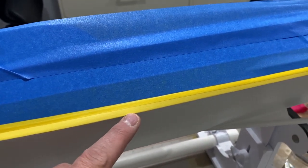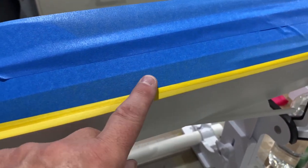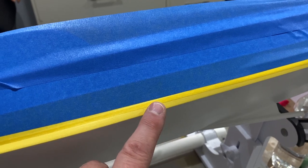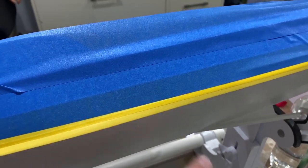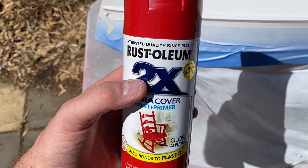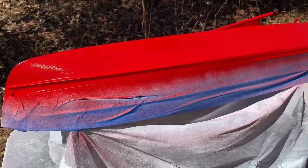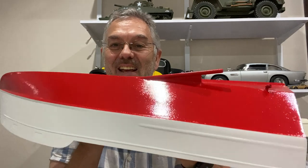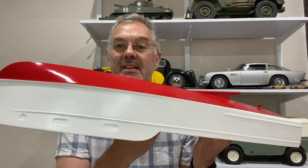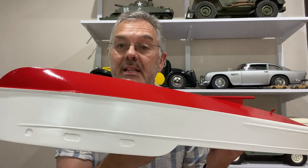So I've got all this masked up. I'm going to use a little trick I read about on the internet to stop the red paint bleeding under the tape line - for the first coat, spray it with white again, so any white paint will bleed under there and seal it, and then when you put the red on hopefully there'll be no bleeding. So the next coat is going to be Rustoleum Gloss Apple Red. Well here we are, it's coming on. So that's the red bottom and the sides - not totally happy with the finish on the bottom, but that's the way it is.